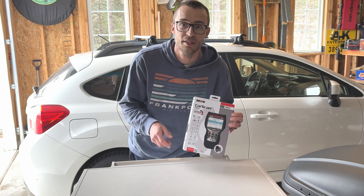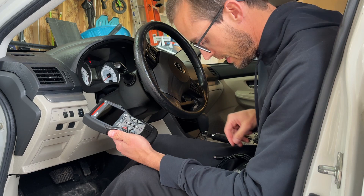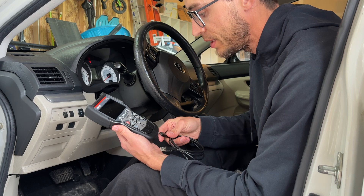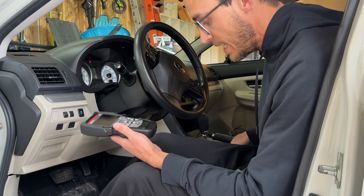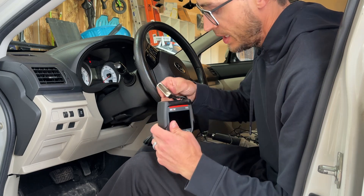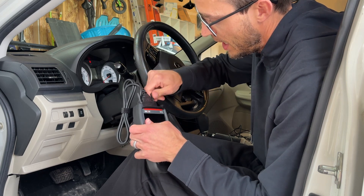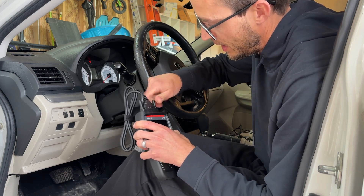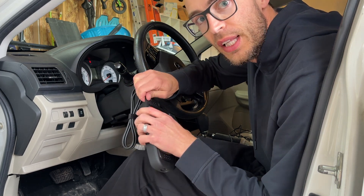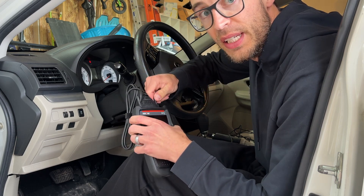If you're going to purchase this, check out the link in the description, and if you have any questions let me know in the comments below. With this Inova 5610, you can use this USB-C cable to hook it up to your computer if you'd like to look more in depth at the diagnostics. Then you use the OBD2 reader port here with the connection on top — you push it on and twist down these screws just like a VGA cable on a computer, which helps hold the connection port. When you go to check codes, you want the vehicle in the on position; it does not need to be running.